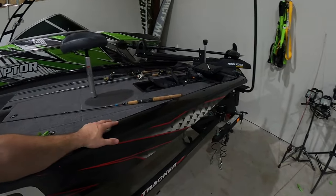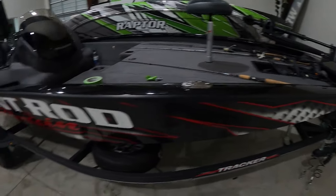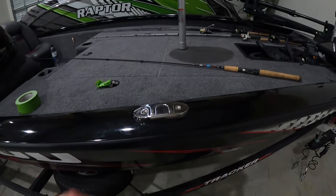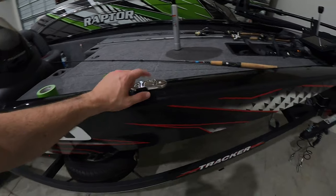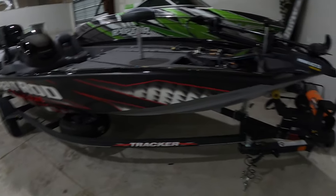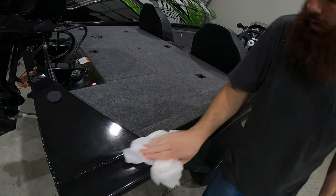Okay, side of the boat's fully wrapped and ready to go. We're going to do the top cap here — we're going to use a lot of the exact same techniques to get this little guy put on there. If this has been helpful so far, give me that thumbs up — it really does help. If you guys are new to the channel and like stuff like this, hit that subscribe button. Other than that, we're going to go ahead and start on the top cap — get it wiped down with rubbing alcohol, get our panel out, get it all ready to go, and then squeeze this bad boy down. We're also going to put a little green tape around these little cleats to help the wrap kind of sink down around them when we trim.